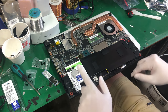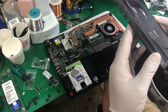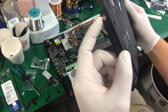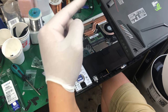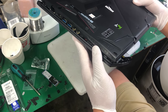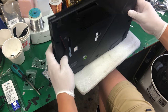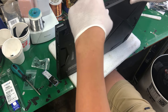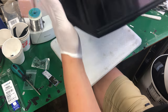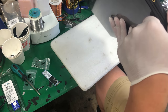We'll go to the BIOS to confirm the new drives are recognized. With the battery plugged in, I'm putting the base panel back on. For this model, the audio jack holes are designed so you can't just drop the plate straight down — you need to insert it at an angle so the audio jacks align first, then close it. The clips we didn't break are helpful because the panel clicks back on securely even before the screws go in. We'll put the screws back on after verifying the upgrade was successful.